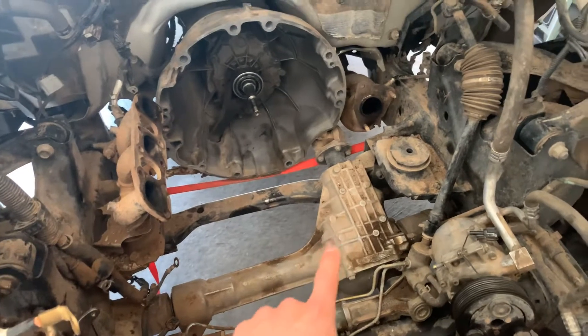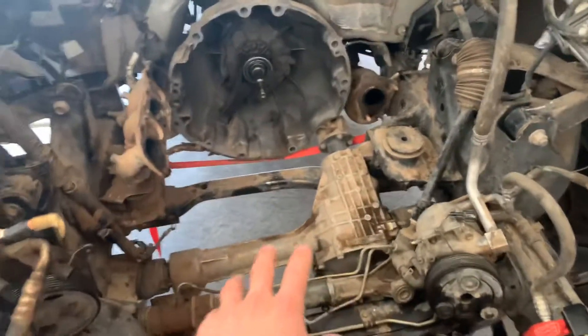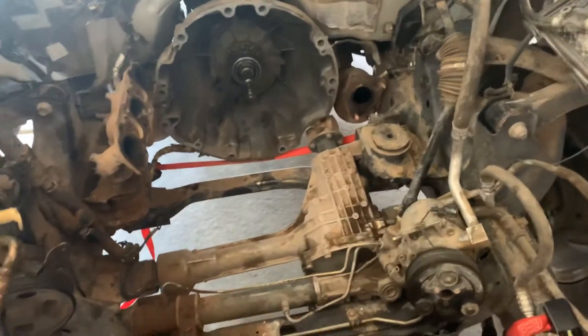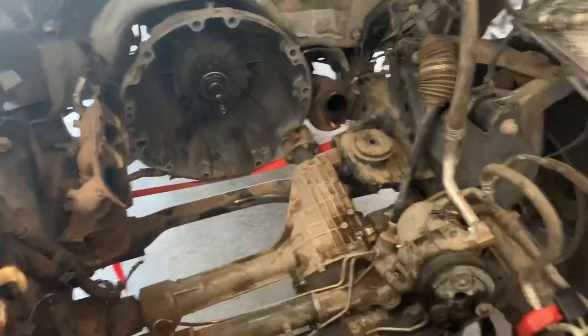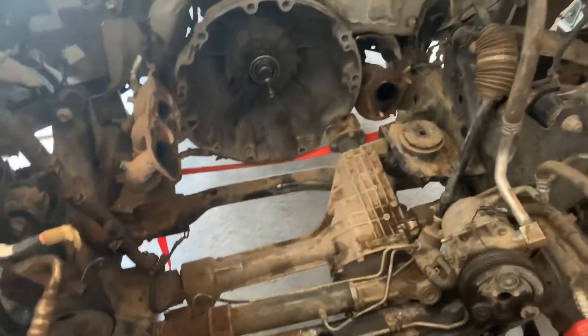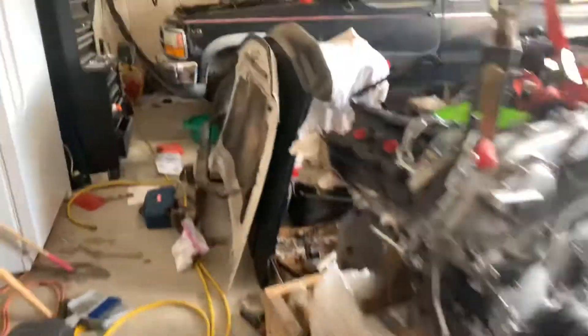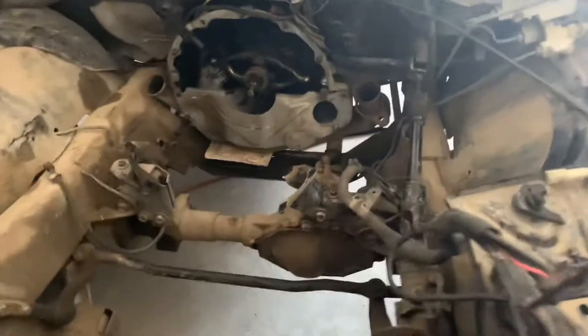For this truck you may not have to do this for all vehicles, but you might have to drop the diff or remove the oil pan. I just dropped the diff because it was a lot easier — I didn't have to mess with any components on the long block. It's like three big bolts and that thing just drops down out of the way so the oil pan can clear it. On Debra there's a lot more clearance so you definitely don't have to take off the oil pan.